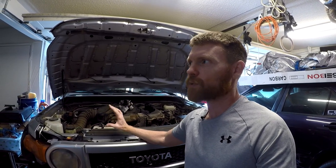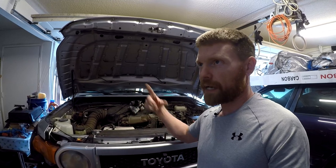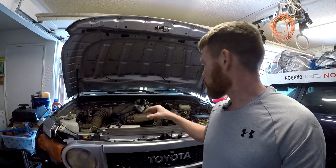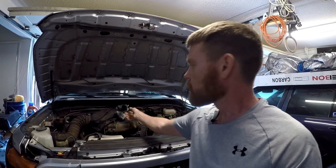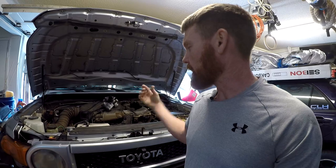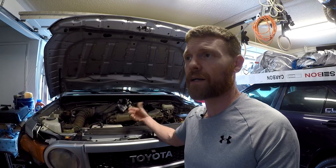It's the cheapest one I could possibly find — $20 with a thermostat included, some cheap Chinese thermostat I would never put in this FJ Cruiser engine. What I did was grind down the edge of a Toyota thermostat from a '90s something so it would fit, held in with a snap ring. The inlet was a smaller diameter for the Honda engine, so I had to use an old bicycle tube cut to length, slid over with the radiator hose. It hasn't been leaking at all, though there are a few little signs of leaking around the sensor ports, so I put extra sealant on it.